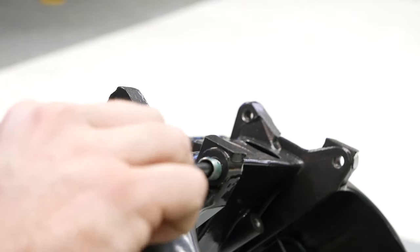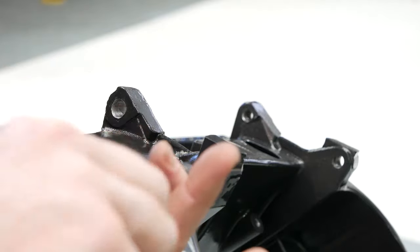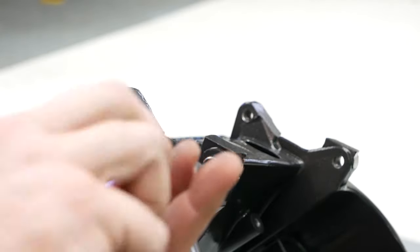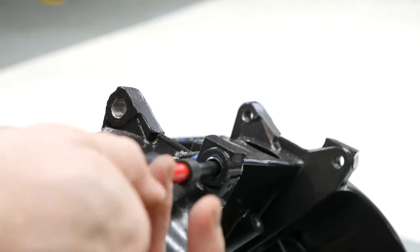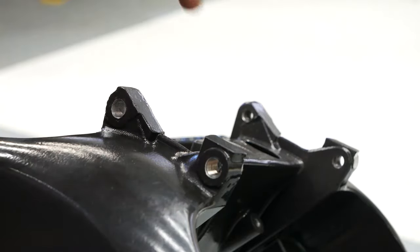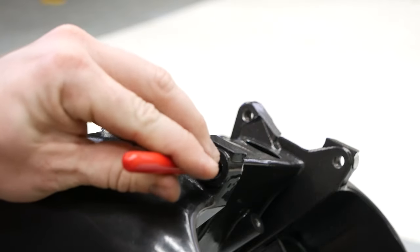So this time I'll be a lot more gentle when I start it here, and be careful not to push the helicoil any with the tool here. Looking good so far? Here we go. So first one's in. Last, you come in with this little punch they provide and knock out that end tang.